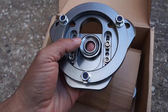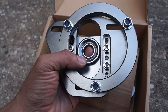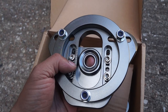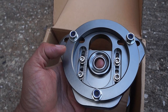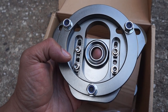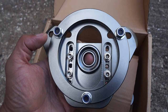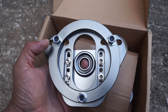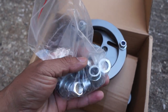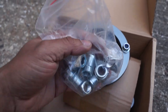The way that the wheel sits in the fender well is basically a direct result of where the caster is set. The factory settings have the caster set about in a particular position. With a standard camber plate set at the center, you only have camber adjustment positive and negative. While that works for non-M3s, it's very bad for the E46 M3 — you get issues with self-centering, tracking straight, and inconsistent straight-line driving. We're going to be installing these on the BC coilovers. They came with an assortment of collars to fit different coilovers, and one of these should definitely fit the E46 BC BR coilovers.